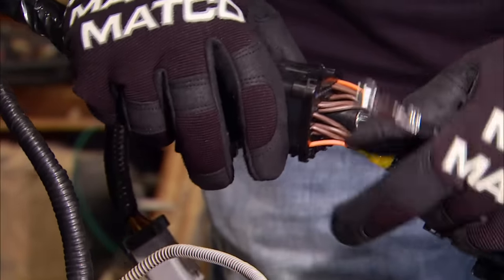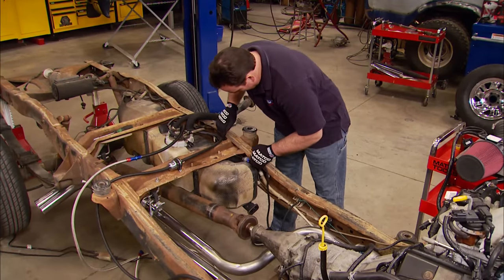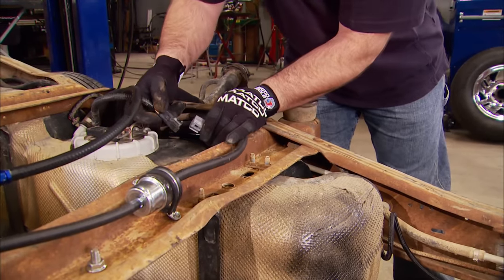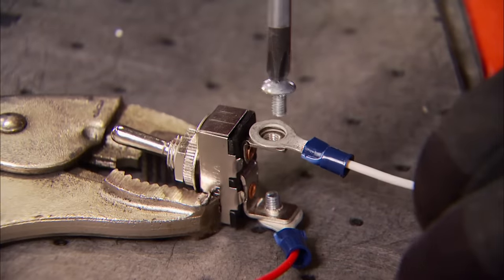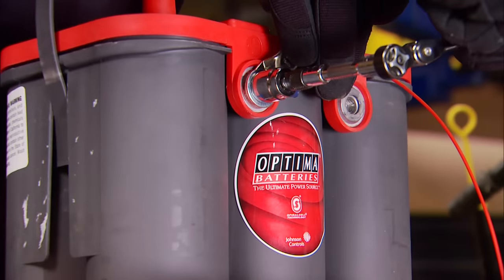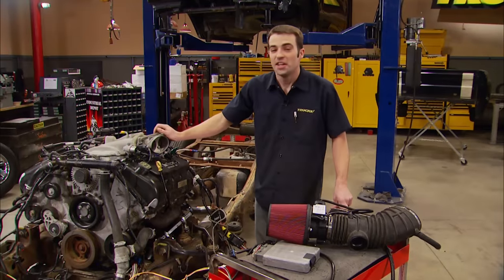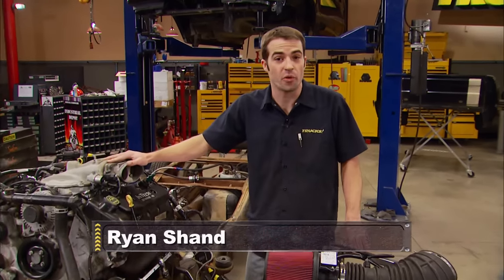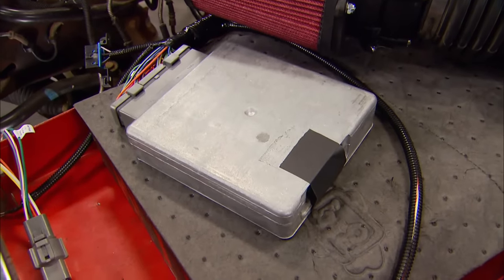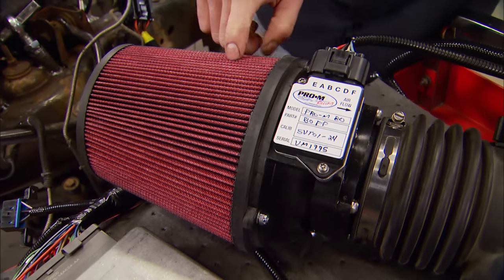This system uses a factory-style multi-pin connector and plugs right into the existing engine harness. Don Barron, also from Dunrite Performance, came down to help us fire off the Ranger. He's routing a power feed to the existing four-cylinder fuel pump just so we have a fuel supply to start the engine. This is a demonstration of how simple the system is to hook up — we're using a toggle switch as our key-on voltage source, connecting the basic connections to a standalone battery, and we'll be using a remote start later on to fire the engine off. Jeff also provided us with a 99 Cobra production PCM with a chip installed that disables the passive anti-theft system, along with an 80-millimeter Pro-M mass airflow sensor and high-flow conical filter.